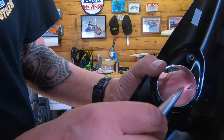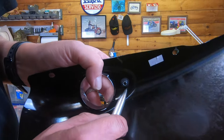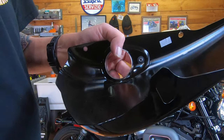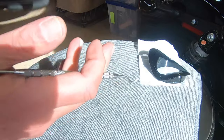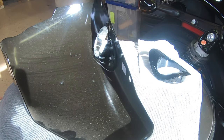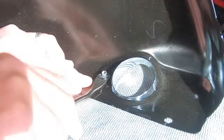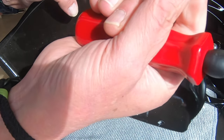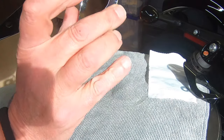You can see this trim ring, which is plastic by the way, is held on by a push-on washer right here, and we're going to pry that off real quickly, pop on the new one, and then pop her back on. Whenever you're laying any painted surfaces down, make sure you get a nice soft clean cloth. This push-on holder is going to be a rascal to get off. And there we go. These always get destroyed when you take them off, so they're throwaways — you can't use them again. With that said, this should slide right off, which it does.